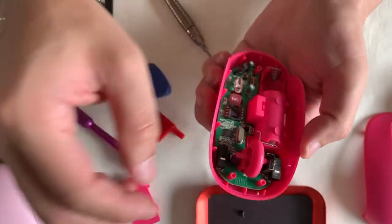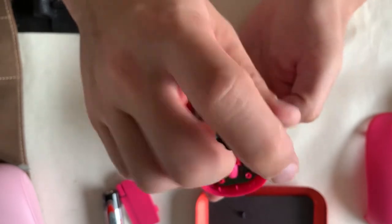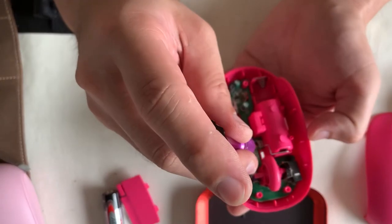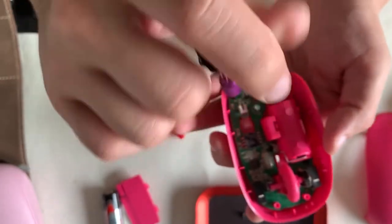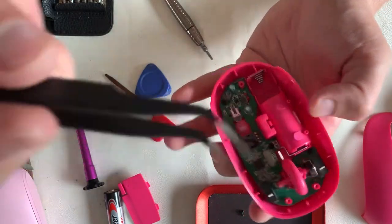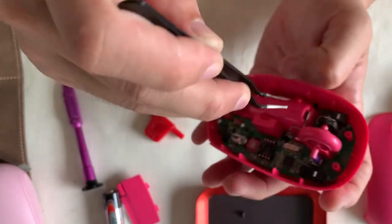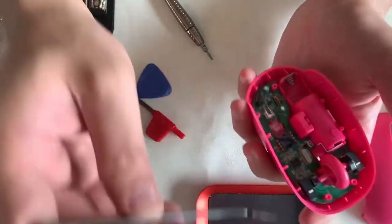We have a first glimpse of the inside. Be very careful when removing the scroll wheel — it's a very common problem because the part where it attaches to the sensor is really thin plastic. Any chance you put it in your backpack and add some pressure on the scroll wheel, it will break. There's a modification that can be done — I've covered it in my first video if you'd like to fix your own.